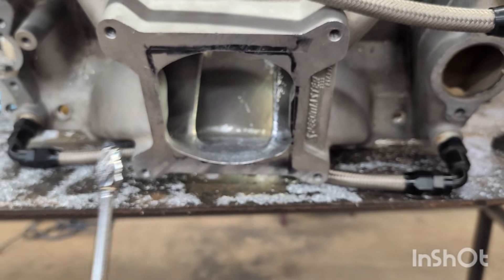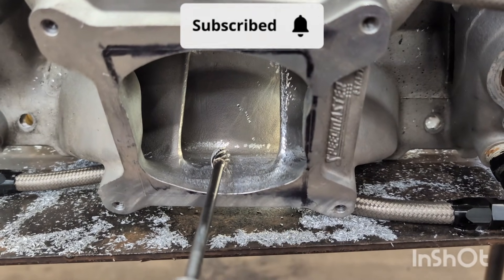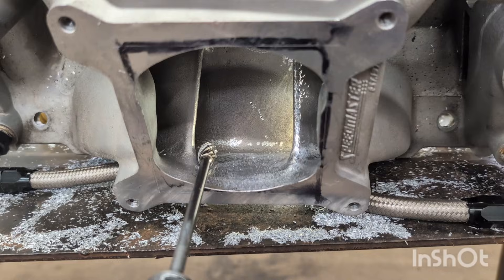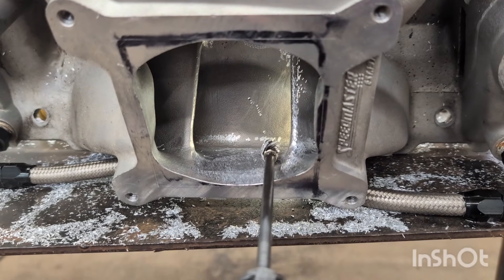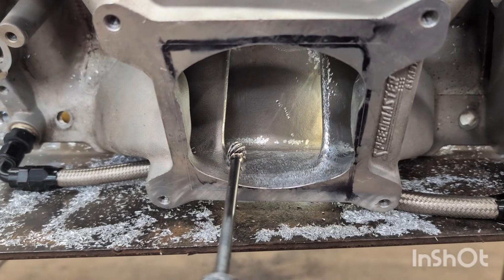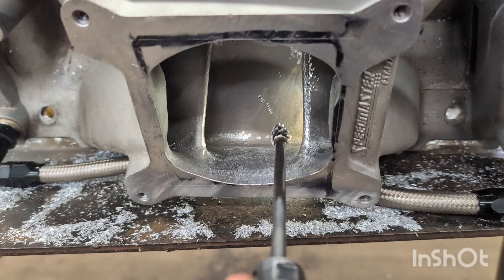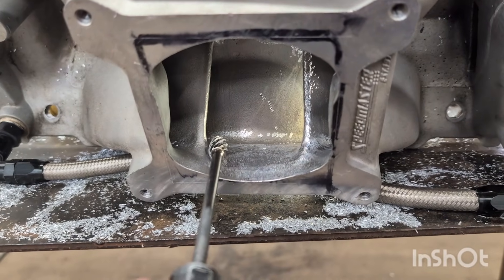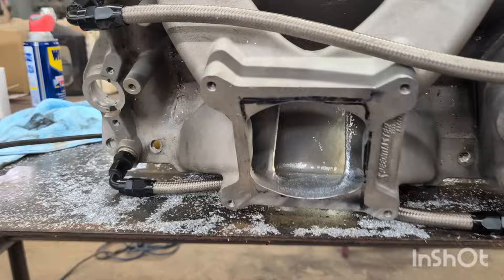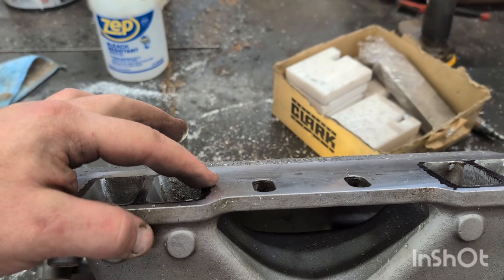Very, very crucial — do not scribble. What do I mean by scribbling? Scribbling would be going in here, grinding away, and just doing this back and forth scraping. You're stopping here, stopping here — it's going to grind grooves in these corners. What professional head porters do is they go from here — it's spinning clockwise, so they're biting, letting up, coming back over. Biting, letting up, coming back over. Pick the bit up, bring it back down, grind the line. After a while you'll be able to just let it skim the surface and then bite. Just like doing the gasket job — if you go past the line, you've passed the point of no return. You've screwed yourself and you might have to buy a whole other intake manifold. No scribbling.